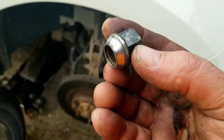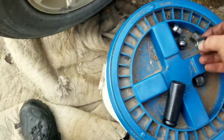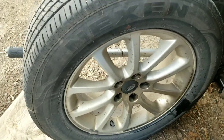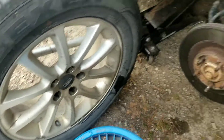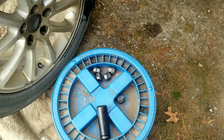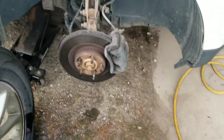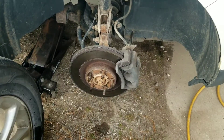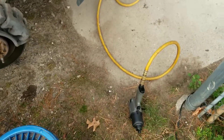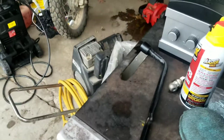You can see there are just open standard old-style lug nuts, and I would not recommend ever using these on these newer cars without hubcaps, through a rim like that, because they just don't keep the dirt and rust and corrosion out. It was a pain getting those off — it took me two hours using a big half-inch drive impact, a torch, and PB Blaster, just going back and forth heating and spraying and hitting it with the wrench. I tried using the tire iron that came with it and actually bent that.